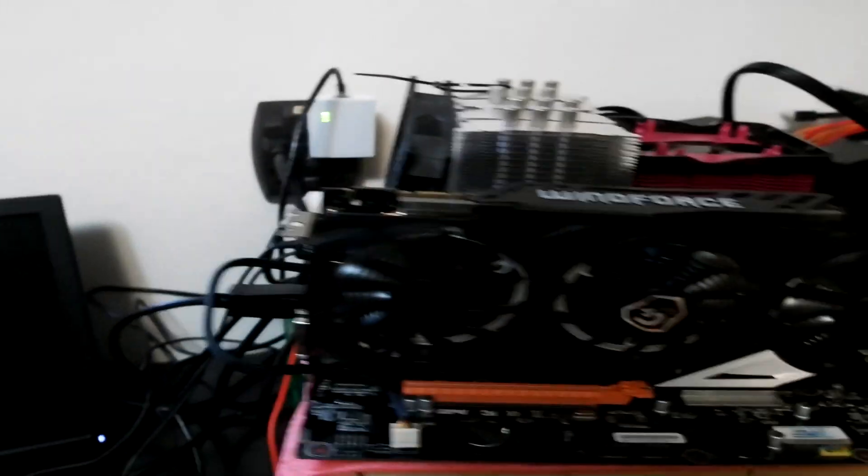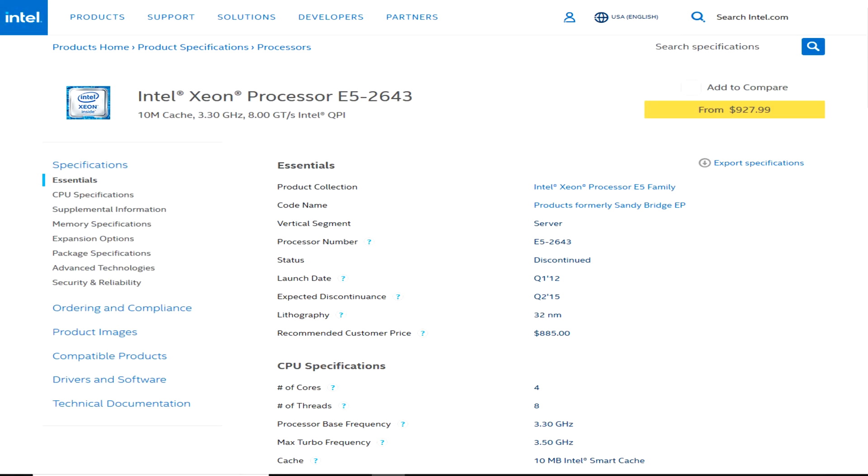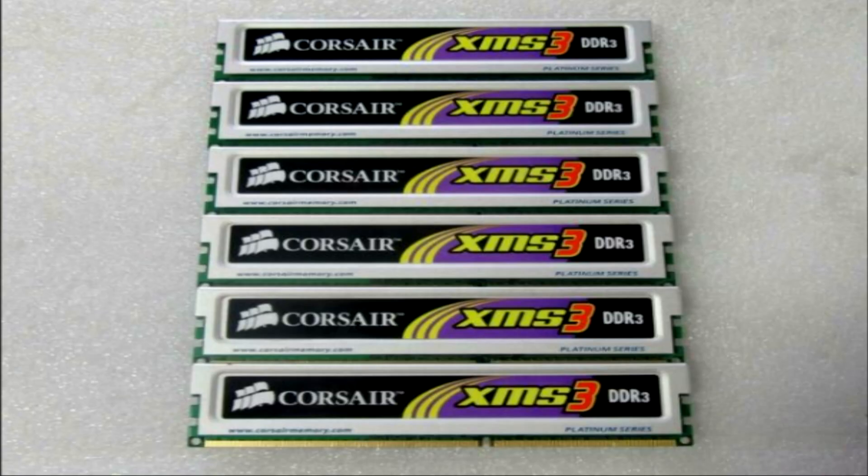This is kind of what I threw together when I saw an opportunity to pick up one of these motherboards. I got this motherboard for about $125-ish shipped to the United States from China, and at that price point it's really not bad. The CPUs I decided to go with were the E5-2643s — you can buy two of them for about $25 US dollars, and I already had one, so I got both of mine for about $22. For the RAM, I simply grabbed what desktop memory I had available, which was my Corsair XMS3 Platinum — 1600 MHz RAM out of the box — and it ran very well.